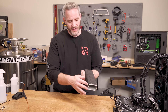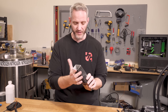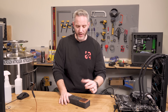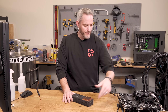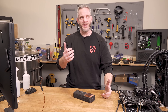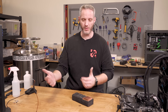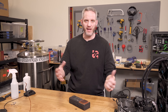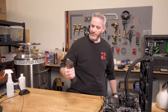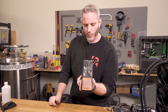I've got to re-insulate this. This is all the adhesive and insulation that's still stuck to it, which is still perfectly fine. All we want to do is keep air from touching the metal so it doesn't frost up really bad. It's good to tear it down like this because water can get trapped in here and then freeze. When you do your warm-up runs to try and cure the paste, it can run and freeze up the socket — we've had ice form in the sockets before. It's also good to get the screws nice and tight again, because the constant temperature fluctuation from extreme cold to room temp will make the metal expand and contract, and the screws can get loose, making it impossible to get an even mount. So I'm going to remount this with the bracket, get it all clean, get my thermal paste cleaned out, and basically do a full reset.